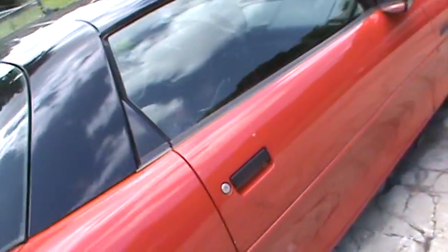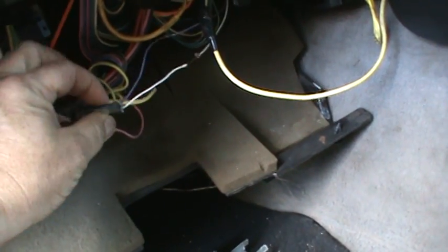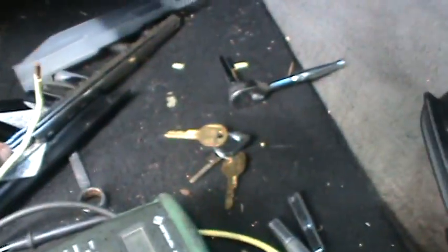I've been working on the Camaro. I watched several videos. Thanks to you guys that sent links over. Once I started watching a couple of them, a lot of videos popped up. And I located my wire right here. Somebody had a car alarm spliced into it here, so I'm gonna cut it up here and reattach the plug, solder it in, and then test my resistance there and on the key right here. I think I tested that, and it's like 1 point something ohms, 1.7 or 1.8 ohms. And I sent Andrea down to Radio Shack to get me a resistor pack.